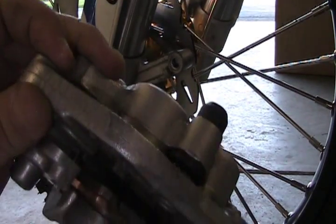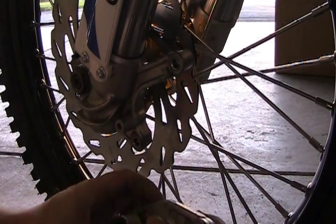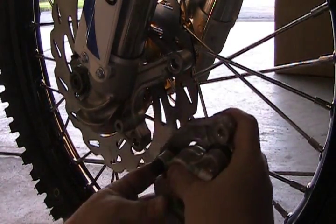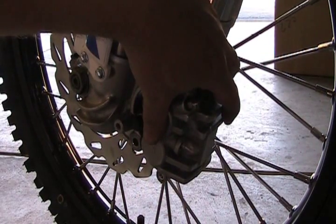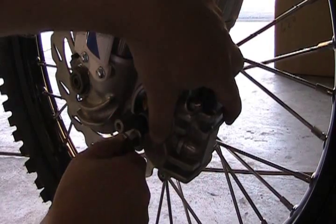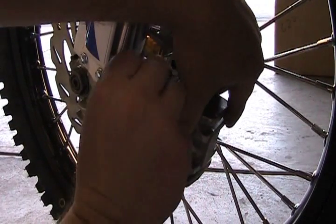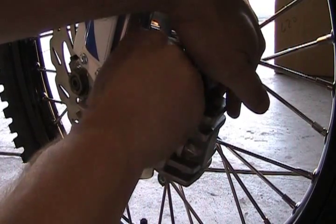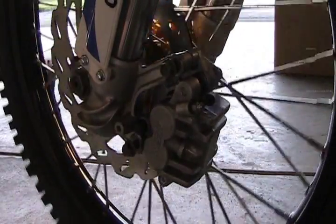Okay, the bike, now we're still holding this kind of closed. On the bike, it's pretty simple. It only goes one way. Goes like such. You see that? And I have to slide it over the rotor. And then kind of hold it in place. And then just get your bolt started. And that is essentially it. Tighten everything down to the torque specifications.